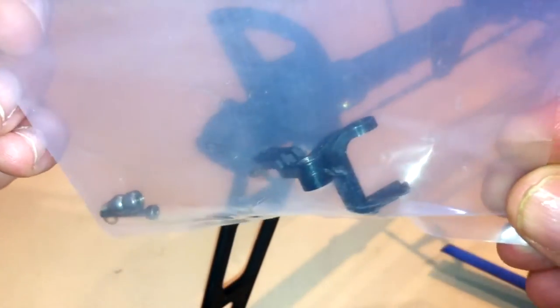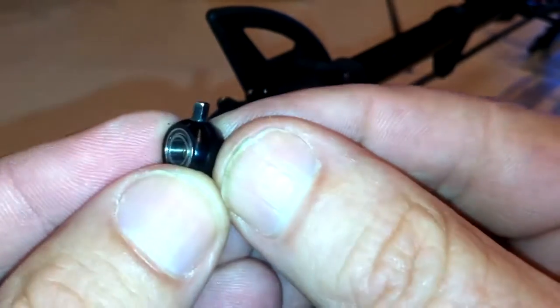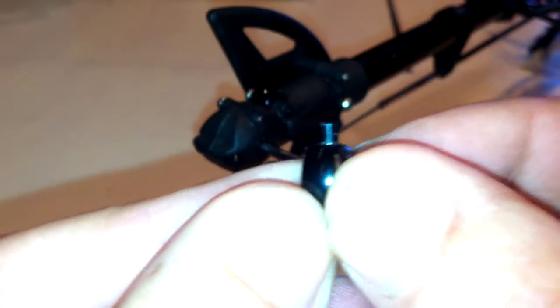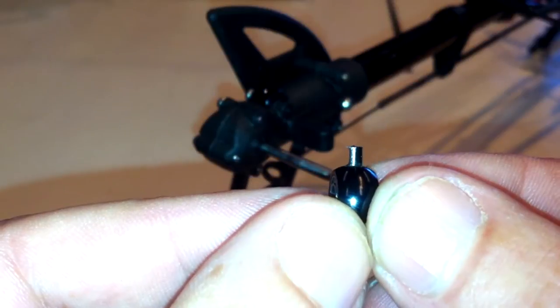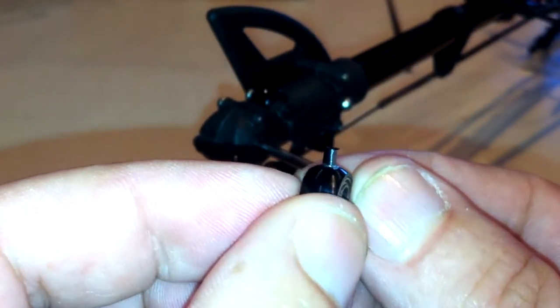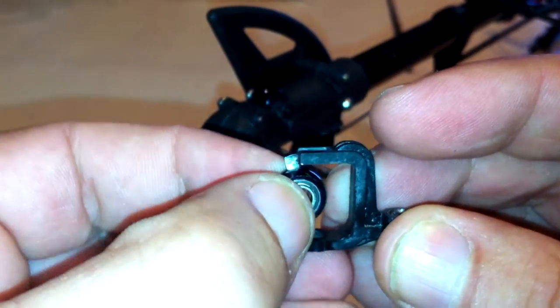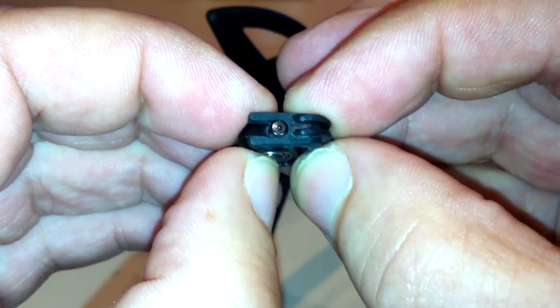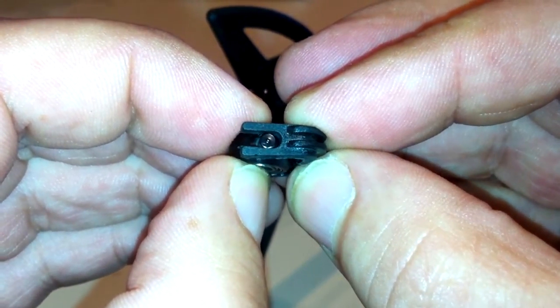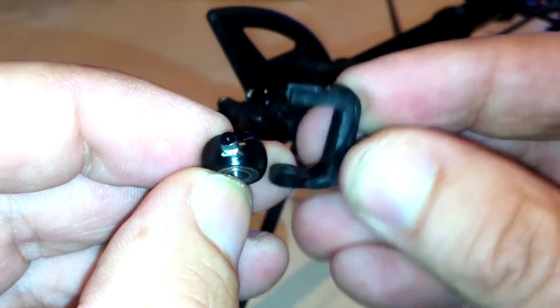The other part there is the control rocker, which is that unit there. As you can see with the old parts that I've pulled apart, you can see a fair bit of wear that it has got on it. You can see the little lip on the top there and the big flat section that it's got there too. That's not actually supposed to be in there. Where this rocker arm goes on, obviously there's a ball that I've broken off, but that just slides in the top there. And you get a lot of movement.